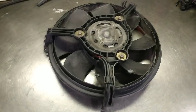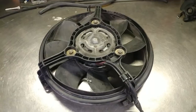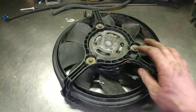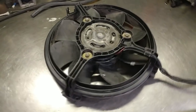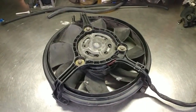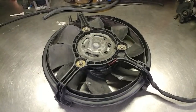Somebody in the past, maybe sometime last year, asked me how to remove it, and I said move the lock carrier into the service position. Yes, I've been working on these things for over 20 years, but there was lots of stuff that I had never done. This was the first one that I had to replace. And when taking a closer look, that's what I realized. There's just a retaining screw. You move this, and this whole thing can come out without moving the whole radiator into service position. So now I can share the information that I gathered. Learn something new every day.